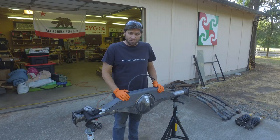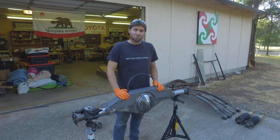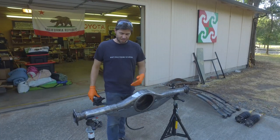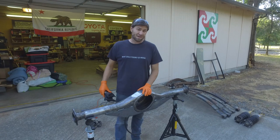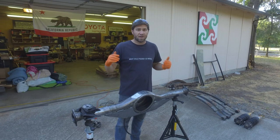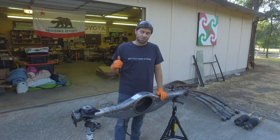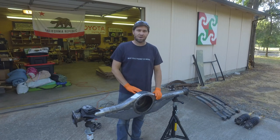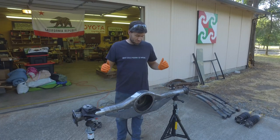And that's the number one thing that I don't want to do, is warp this axle. So I appreciate having friends that know more than me. I don't like doing things twice, but I do like doing them right. So today I'm going to be flipping this guy over and cutting all the welds that I've already put on here to take this thing off. And then I'm thinking I might fab up a little welding table so I can cinch this down and weld it nice and tight so that it won't bend or warp while it's just on the table cooling, and then I'll weld it to the axle. So today is gonna be a little bit of backtracking, but it's gonna be better overall and smarter for us to do. So I'm gonna get to cut it.